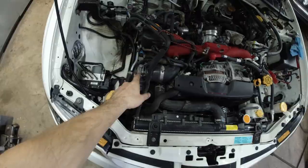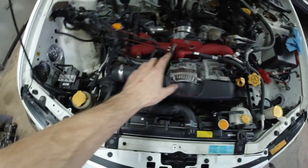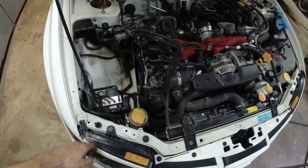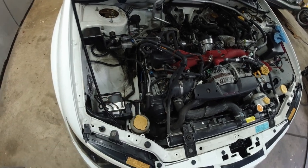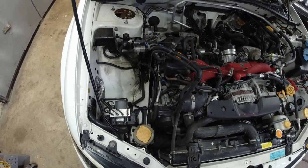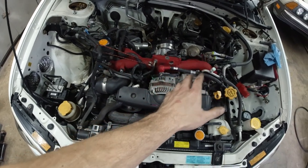You saw the numbers. Here's number one, number two, number three, number four. So a 20% difference is too much. They should be, if they were all at 120, that'd be nice, that'd be good. 128 or 130, I can't remember, but a little bit higher would be ideal. 120 is still okay. Too much of a difference between highest result between the lowest result. So now I'm gonna go and check the play on the turbo.